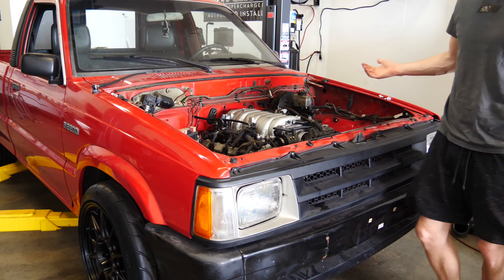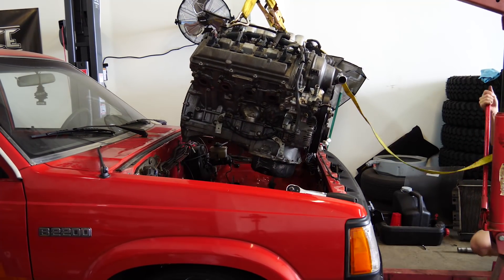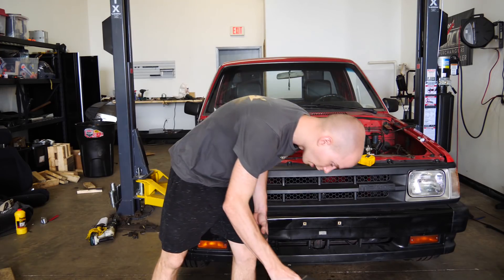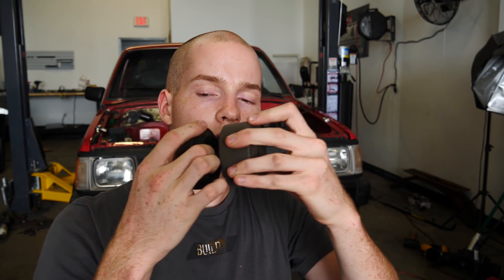I have to undo the motor mounts. I got some nice thick sheet metal and this tool right here is a punch and flare tool. You use it on sheet metal to punch those cool-looking dimple gusset things you see on roll cages, and it makes the sheet metal significantly stronger. One side goes on one side, the other side goes on the other, you tighten the bolt down, and it punches a hole and bends it into a nice strong shape. It looks really cool too. We're going to use this tool and sheet metal to strengthen things, spread the load, and make it look pretty. This thing was about $130, which kind of sucks, but let's try it.